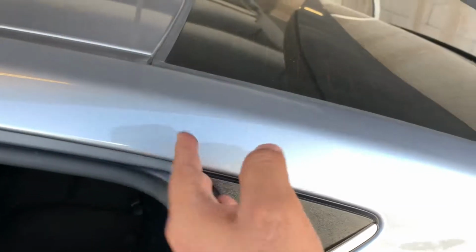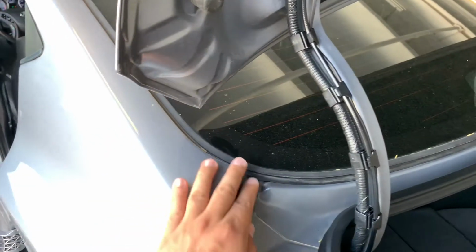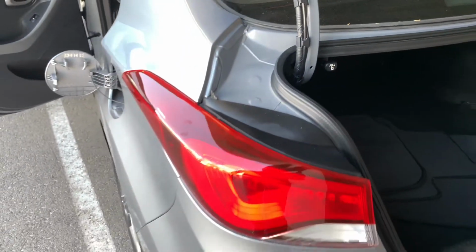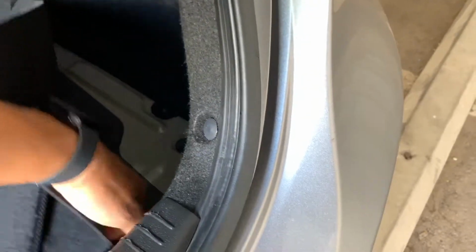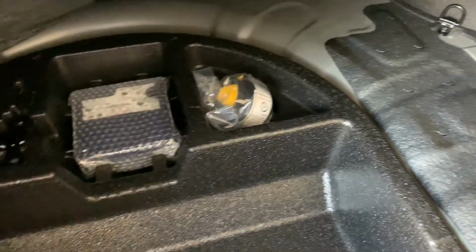But you also have your rocker panel, your inner rocker panel, your center left and right rail. This right here that I'm showing you is your C pillar, which runs up to there. And in some cases you have a D pillar when it's an SUV, but in this case you don't, because it's a unibody structure car. Some cars can have a hatch too. Now I'm going to show you a little bit underneath, which is called the floor pan.